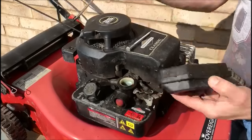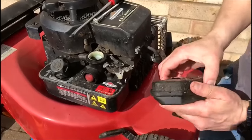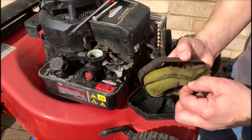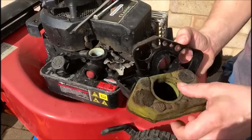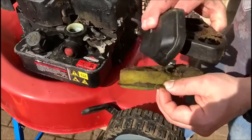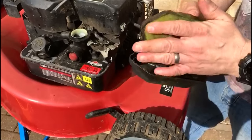So we're going to take the air filter off. Now as you can see this air filter is filthy, so we're going to have to give it a good clean. That's where the petrol comes in handy — you can clean that out in petrol. I've seen worse, it's not too bad, but we'll get all that gunk off and give that a good clean out. People wonder why the lawnmowers aren't starting, but that's not fantastic anyway.